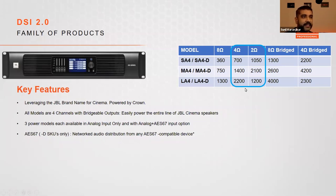The MA and LA are essentially the same amplifier but tweaked for different applications. The MA is tweaked to give more current into loads, important for long-term sustained SPL needed by subwoofers. The LA is tweaked for higher voltage output, needed for instantaneous SPL required by screen channels and surrounds. If you're looking for amplifiers for subwoofers, the MA is the one we recommend.